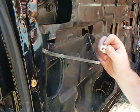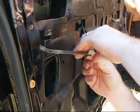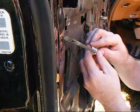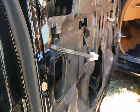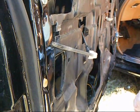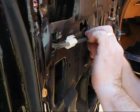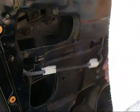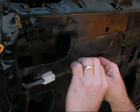These are our new bushings. What you do is take it, spread it a little bit with your fingers, then wrap it onto the stem here. Do that with the front and then the back one — there are two per door. They pop on. Before you apply these, make sure your lock rod is up into the door frame properly.